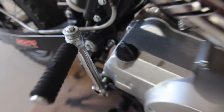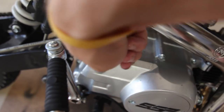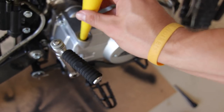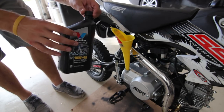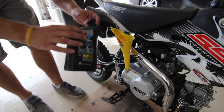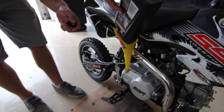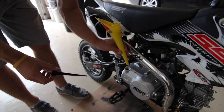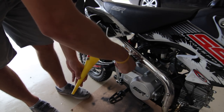Now you're going to want to go back to your motor — there's going to be a little dipstick. You're going to want to unscrew it, and then put your funnel in. Now pour your oil into the funnel. All you do is take your one quart bottle and dump it in until it's all empty. Once you do that, take your funnel out — watch out, it might drip a little. Then put your dipstick back in, tighten it up, and she's ready to start up again.